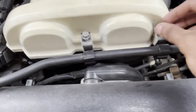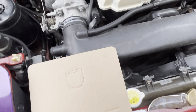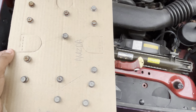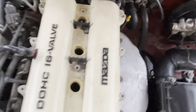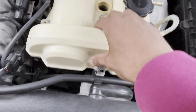Now I'm not going to remember where any of these bolts go, and I don't know if they're all the exact same size. So what I'm going to do is cut holes in a piece of cardboard for each spot and put the bolts in to make a little diagram. I wrote 'front' just to make sure, and I poke the hole where every bolt hole is, then put the bolt in the right spot so I wouldn't forget. They are different sizes too — I did just learn that.